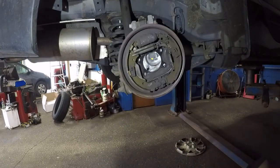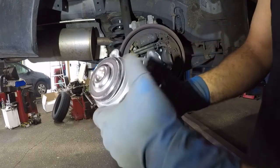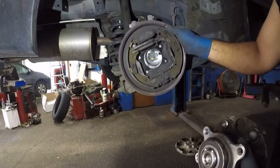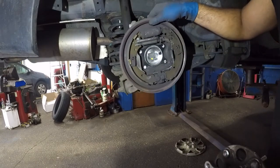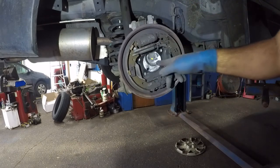It does have an o-ring in the back, so pay attention to that. That o-ring keeps all the dirt, debris, salt, and water from going in there. This assembly is very light — let it sit gently on the brake line and do not try to damage anything.